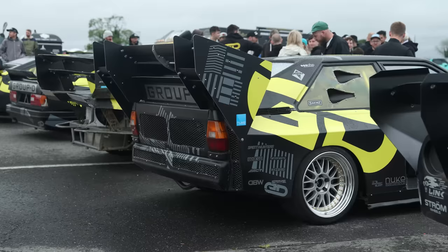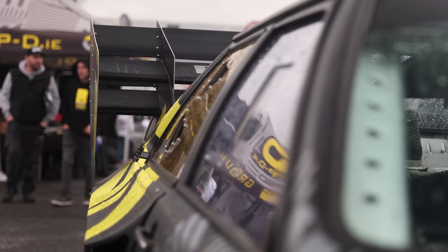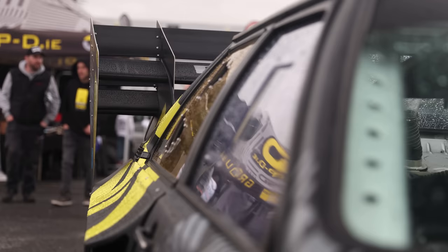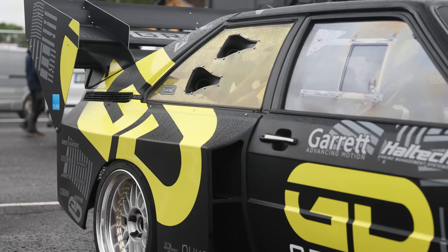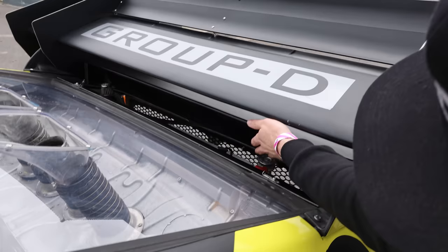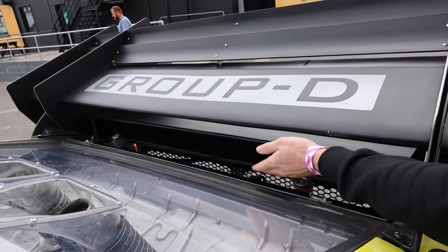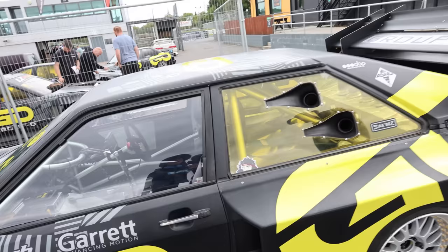So it's the Pikes Peak rear and Group B front, because the Pikes Peak front has that big aluminium aero foil — I mean I love 80s, but that's too 80s, it's horrible. It was the one Walter Röhrl drove, the white one. Michèle drove the yellow and white rally car the year before — that was an Evolution 1, slightly narrow body. This actually takes in air from here and from here. The air divider sends half the air up underneath the spoiler and half down to the radiator — that's how the Group B rally car was cooled. But the Group B car had the radiator against the rear of the trunk, which we thought was vulnerable in a drift car, so we put it at an angle inside and fed it with air to prevent a low pressure area in front of it.